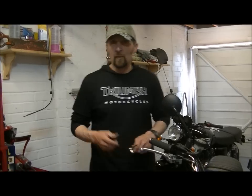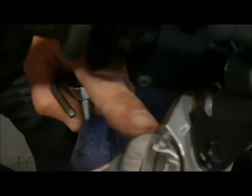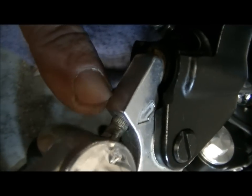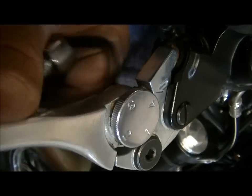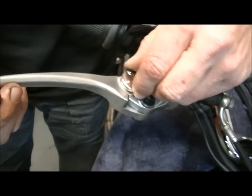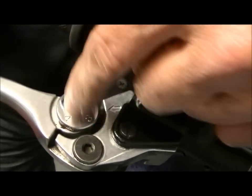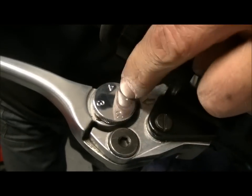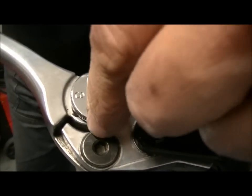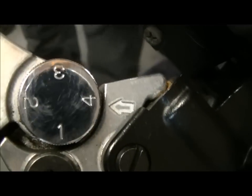How can we get it further in? Short of buying what Penny had on the Harley — which is a very expensive set of Oberon levers — try and take a little look in there. This is how these levers work. That's a little post or stump inside there. And this is a wheel, and inside this wheel is an eccentric cam drum. On the number one position it's at its thickest point, so it rests against this post. On number four it goes progressively lower all the way around — it's a little square cam in there. But that's still not close enough and we need to get Penny's in a bit closer.